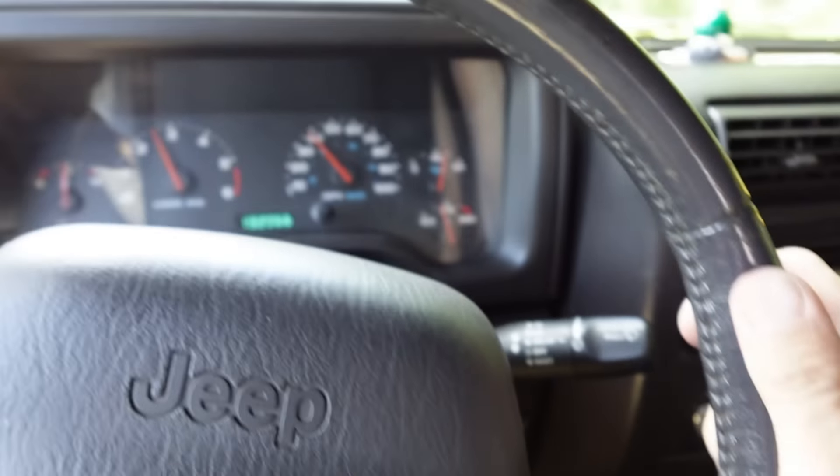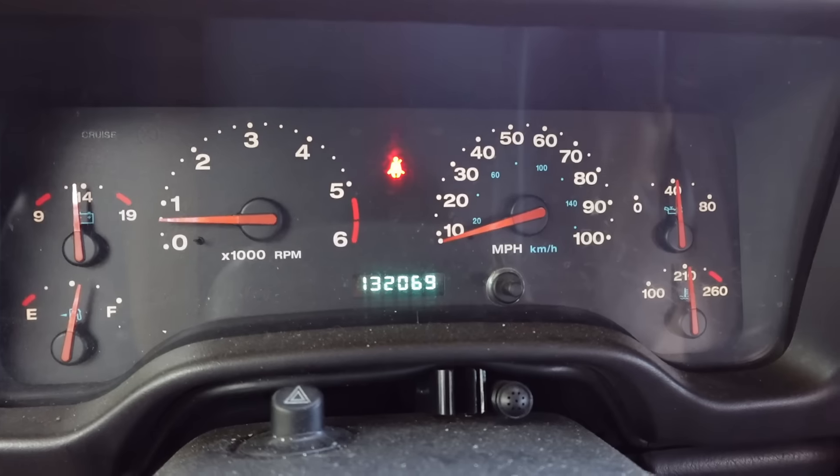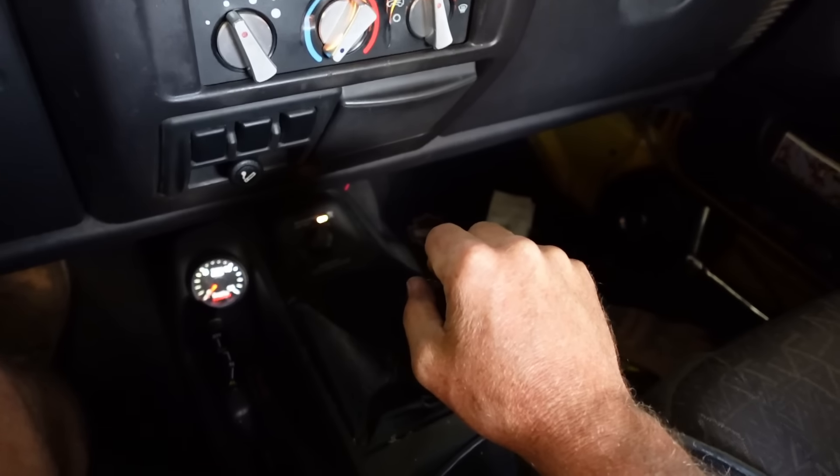It tries to do what it's supposed to, it just doesn't sound right. I drove it around, kept making it mad and acting up until the check engine light started flashing — that means something is really wrong. I still think it might be an injector, but I think this is an '02 model. The '05 and '06 are notorious for a bad PCM. I don't think it's a bad PCM. We'll probably let it cool, get some plugs out, see what they look like, and go from there. I really like this short throw shifter.